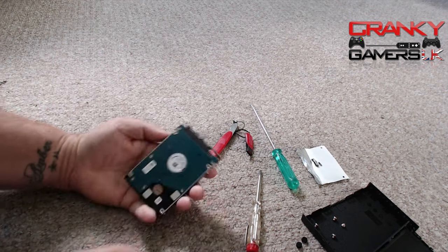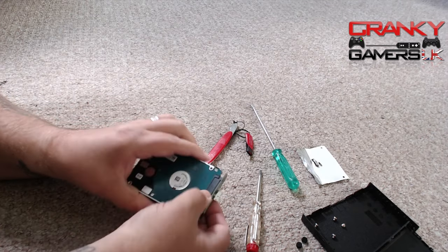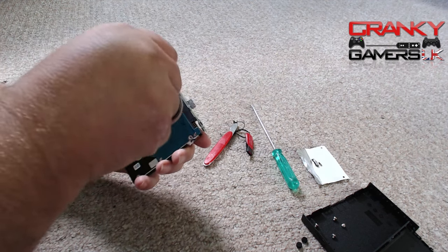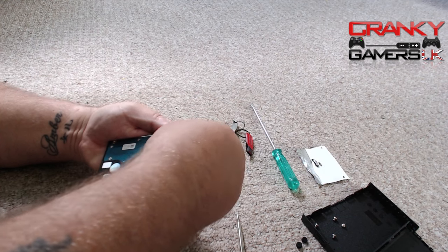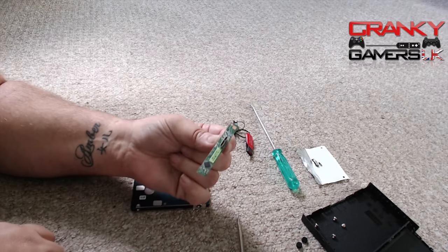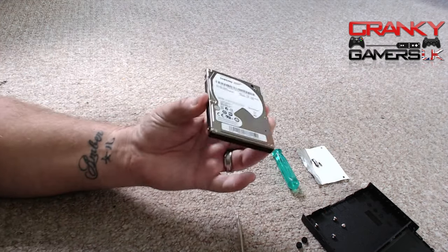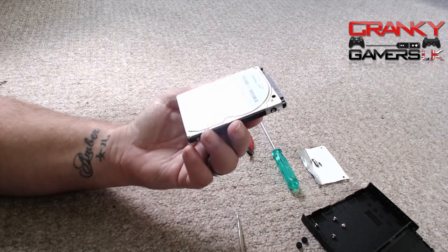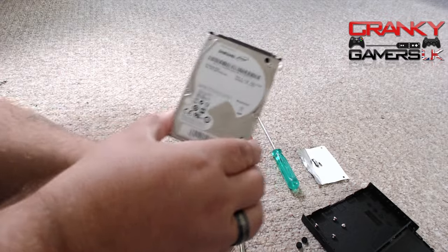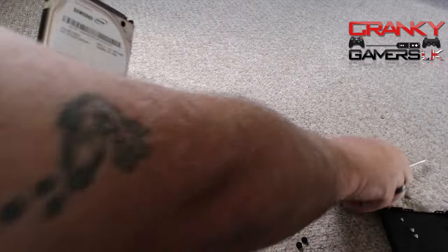What you do next is gently prise this tape off — it's holding the mechanism on. I'm going to try and save this tape for the drive going on it as well. Then gently and carefully get a screwdriver under the connector there and prize it up. There we now have the perfect drive — saved me 25 to 30 quid for less than five minutes' work and a couple of tools. So without further ado, let's now bring in the PS4.